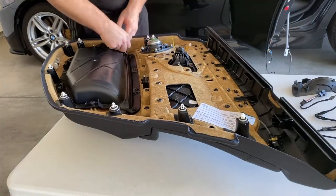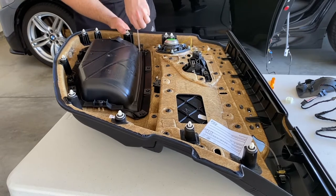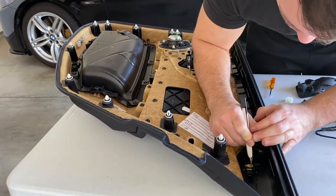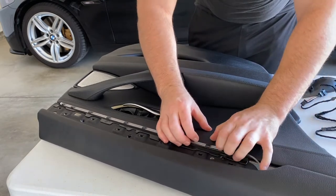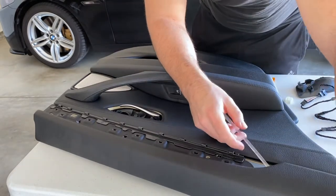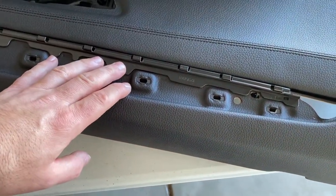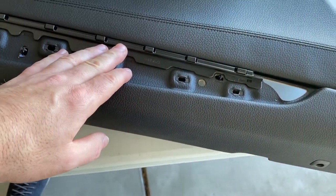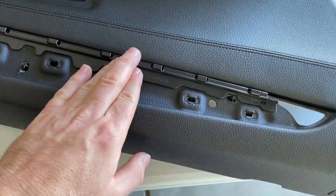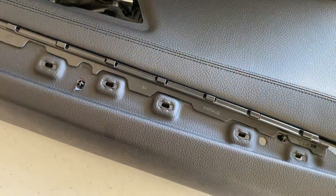On the other side down there you have a little clamp - pull this off and you can remove the entire thing. On the front side, clip it out first and now you can take it out - that's the original ambient slide. You can leave it in, but the LED sits over here shining down and these notches cause a shadow. I tried it on one of the passenger sides leaving it in - in the end I broke it out to have a more even light. I'm going to do the same on this one.